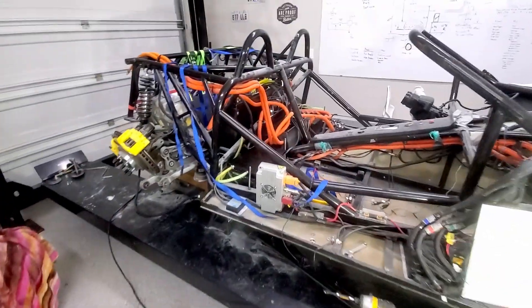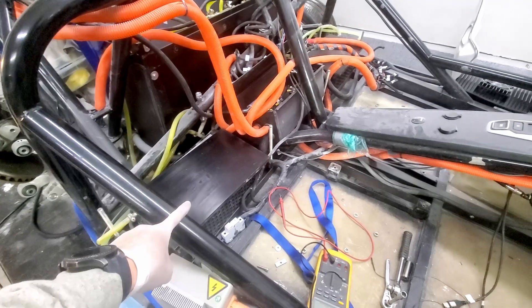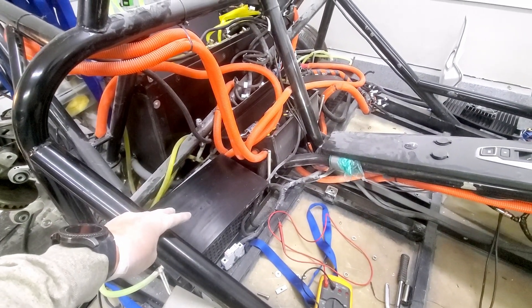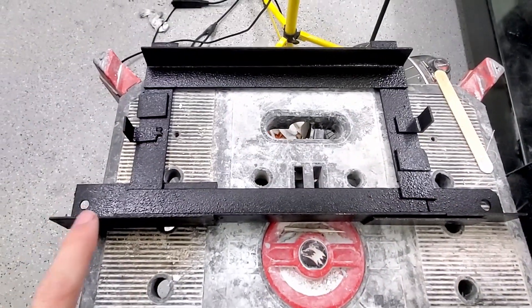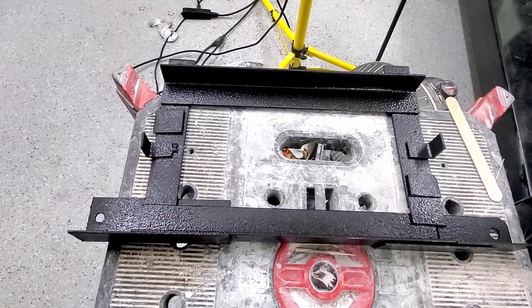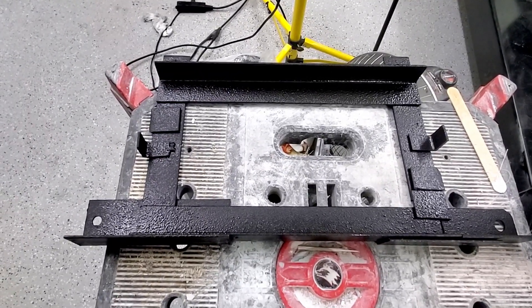Just to give it a little extra isolation. This was all part of pack one, so pack one did not have any problems. But I figure while everything's out, might as well take advantage. One other thing of note: the anodized parts — essentially on the surface they don't conduct, meaning the anodized coating is not a conductor. Something else I learned. I added some of the rubberized undercoating and again, it doesn't conduct. So just trying to find any of those little places that might be giving me grief — I don't think this was one, but better be safe.